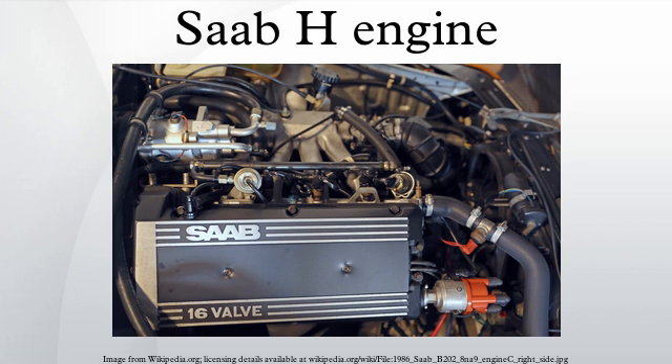The primary difference between the B204L and the B204R is the intercooler, the turbo, and the wastegate base boost setting. The B206 is a version of the B204 but without the double balance shafts. It was only offered as a naturally aspirated engine, the B206i producing 133 horsepower, seemingly a Europe-only option in 1994–1996 non-turbo 900 NGs. This engine is popular among Saab tuners in Sweden due to the lack of balance shafts but with presumably equal strength as the turbo blocks with balance shafts.